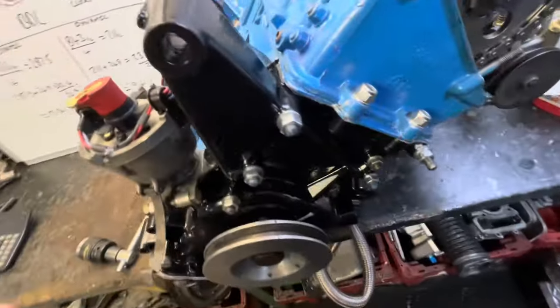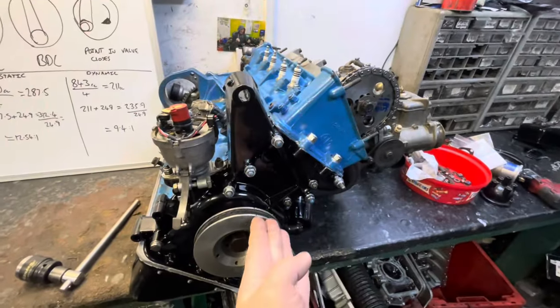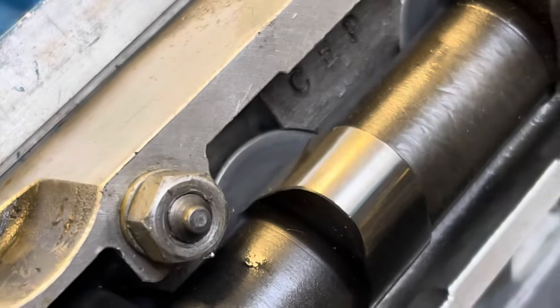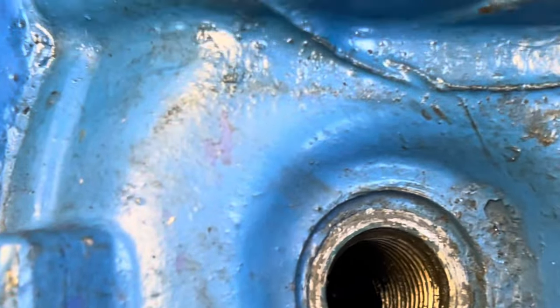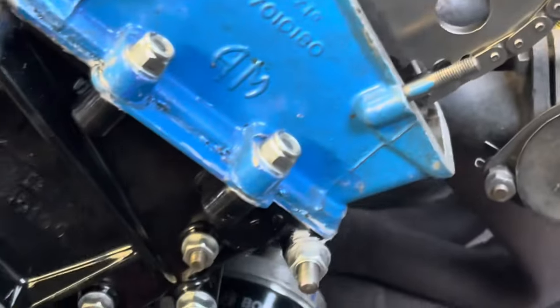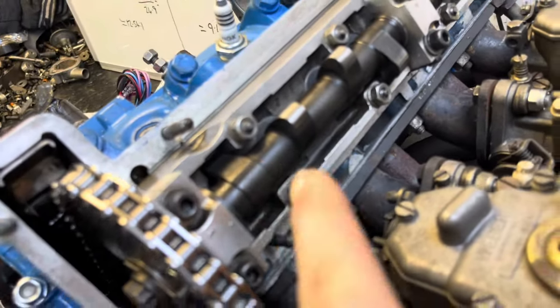What I'm trying to come to: I've set this up to show you the piston now at bottom dead center. With the piston at the bottom, we'll have a look at where the cam is. You can see the inlet cam is still really quite open - if I remove the spark plug we can see it. There's the inlet valve, that's the seat at the back of the inlet valve. So at bottom dead center the valve is wide open. The inlet cam is still open - this is because we have a lot of speed in the engine. We're trying to predict how things are going to go, and because it's happening so fast we leave the inlet valve open, on the hope that the speed of the air is still going in.